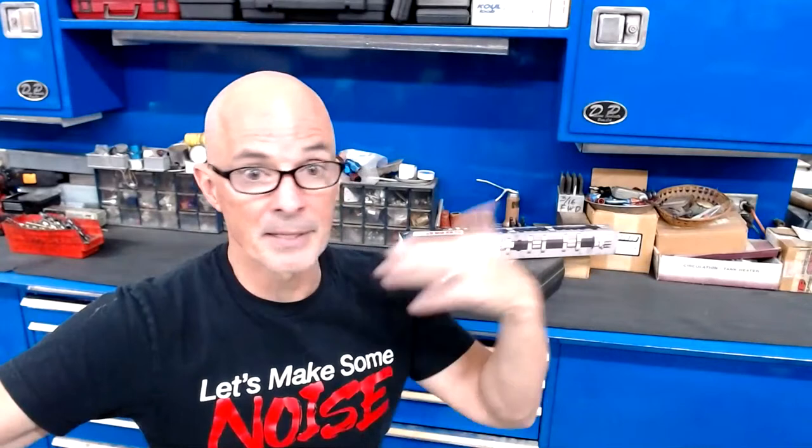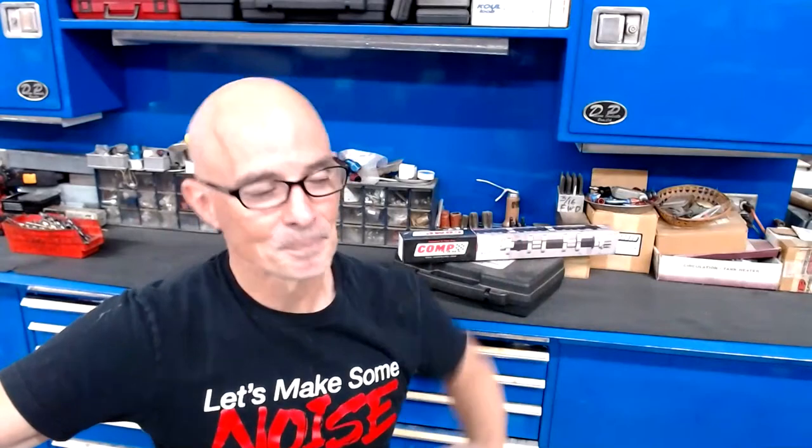What was happening to the Hemi when it broke? That was totally my fault. You can't see it now, but it had Edelbrock aluminum heads on it. And the Edelbrocks have a little pipe plug that goes in them. That's how they make the heads symmetrical. They could bolt on either side. One of them has to be plugged. And so, long story short, the bottom end of the motor filled up with water. And when it did, it reverse hydrolocked. That's why that piston broke, because it was my fault. So, you know, you live and learn.